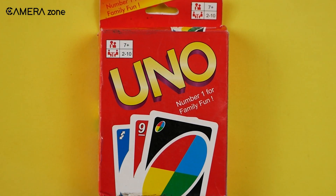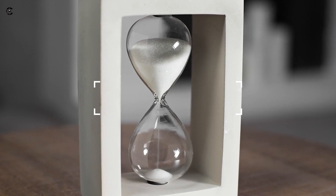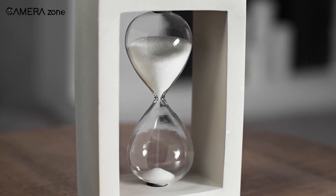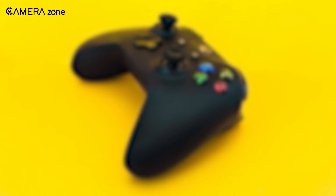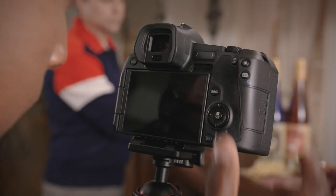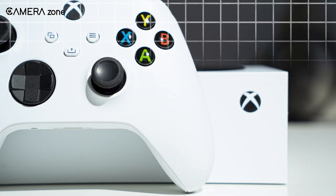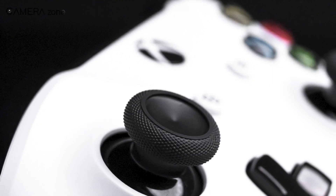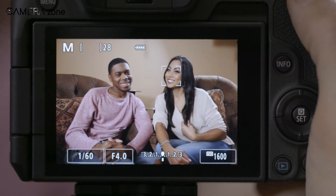As you can tell, there are no fancy gizmos with the contrast detection system. But you shouldn't doubt this tech — it does some things better than other autofocus systems. Two of the biggest advantages of contrast detection AF are accuracy and massive image information. Since the sensor scans everything every time it needs to readjust the focus, you're getting top-notch accuracy and rarely inaccurate. On top of that, if your camera packs more AF points, the more accurate the focus will be. As for image information, it also is the result of scanning the entire scene, so you can get info from every part of the scene and focus on a certain point. That's why we see contrast detection innovation for face and eye detection, whether you're shooting friends or pets.